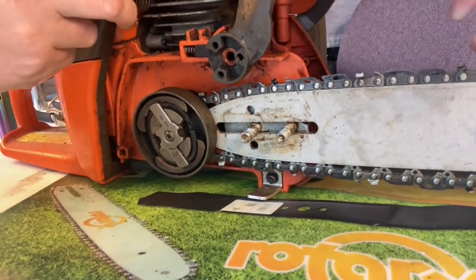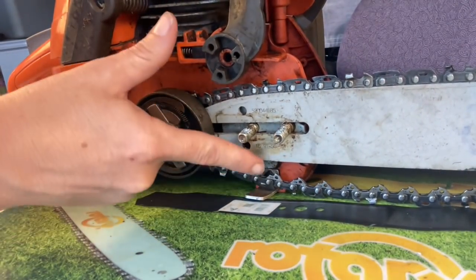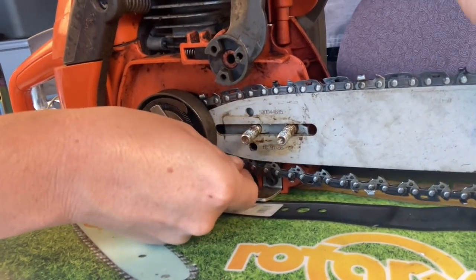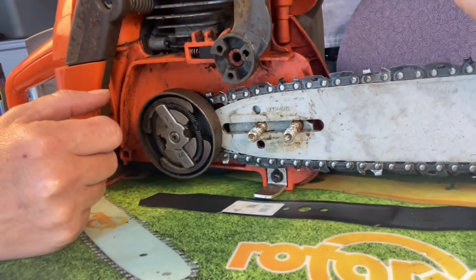You can see it has never even been hit — it's still got its perfect edge right there. As the chain gets loose and comes around, it'll catch that if the catcher has been bent up. Just make sure that your chain catcher is not in the way; bend it down if you need to, and that way it'll save you some time, money, and frustration in the future.